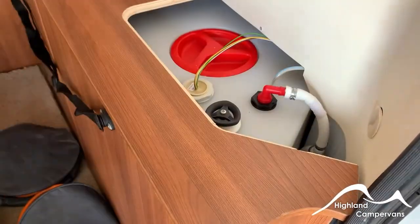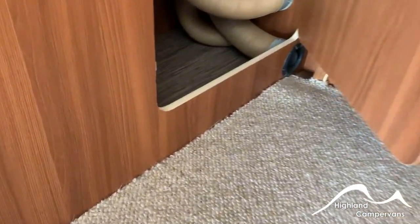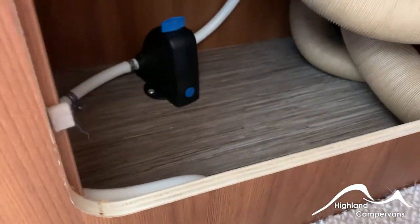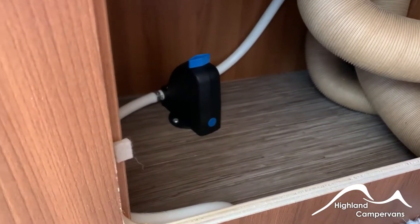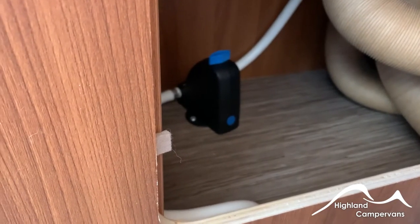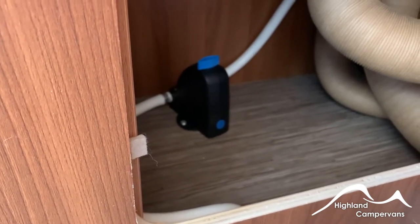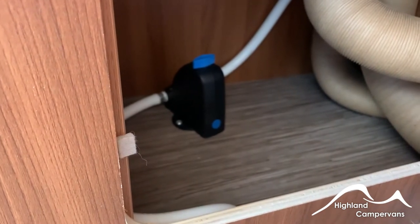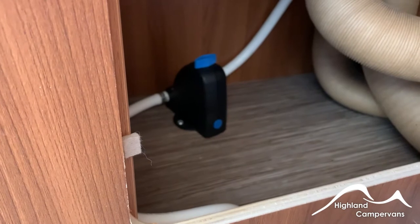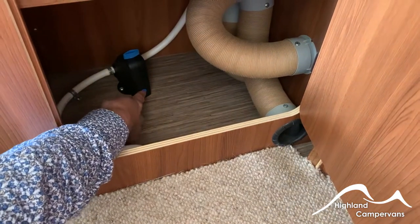It's imperative for winter storage that you don't leave the van full of water, and in conjunction with that there's a drain valve for the water heater as well, located down in the space on the floor in there. The water heater is set up with a blue tap on top — it's in line at the moment, allowing the water system to go through. It's thermostatically controlled, so in the event of the air temperature in that space going below two degrees centigrade, the tap turns through 90 degrees and the little blue spot at the bottom also pops out, automatically draining the water heater to protect it. To reset it, turn it back through 90 degrees at the top, push the blue button back in and you should be able to recharge and fill up the water heater.